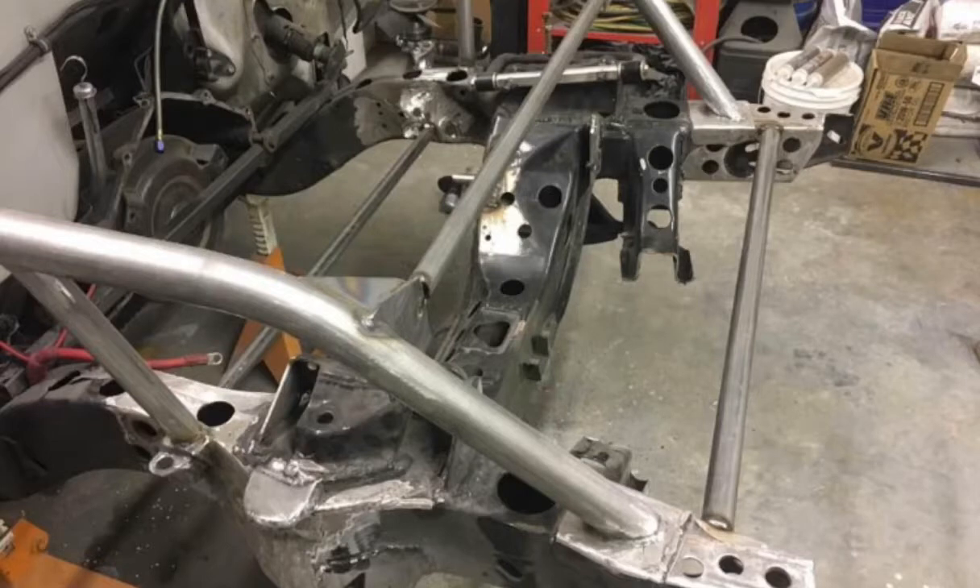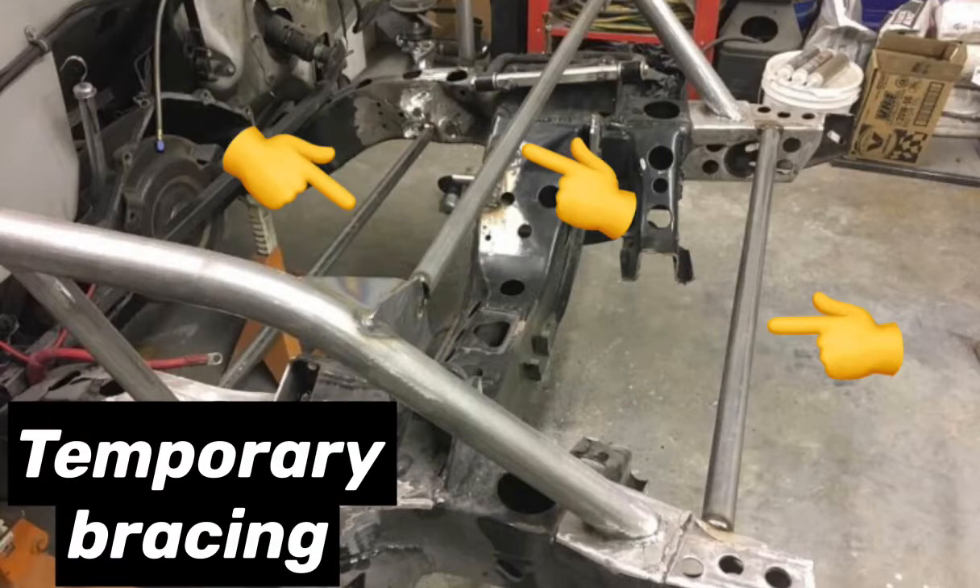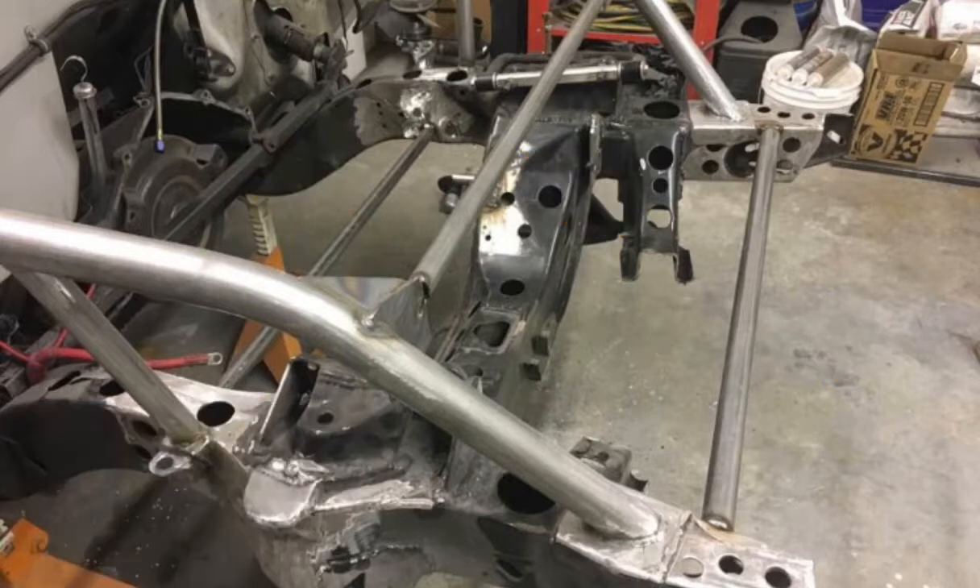After the motor plate work is complete, here you'll see I've welded in some bracing between the factory frame — you'll see them as bars there — and this ties the sides together. Because what I'm about to do is cut the center section away. You can see I've already cut the front section away. I'm going to cut the main K-member, which is a critical part of the car. When you cut that free, you definitely have to tie your frame together so it doesn't spring away, which would create issues reassembling the front clip.